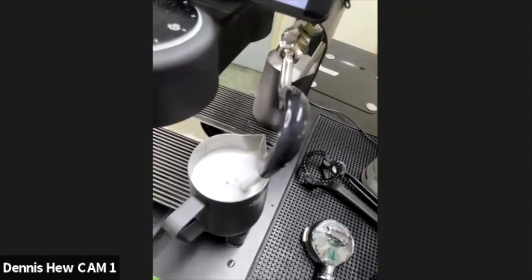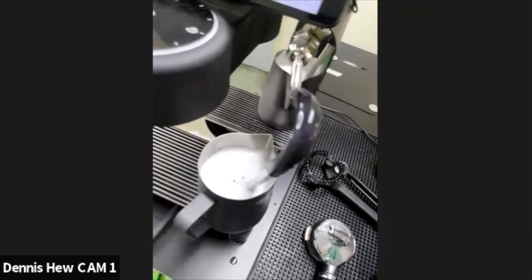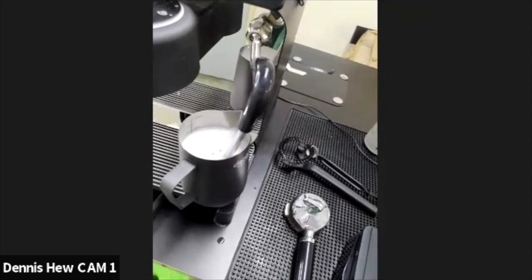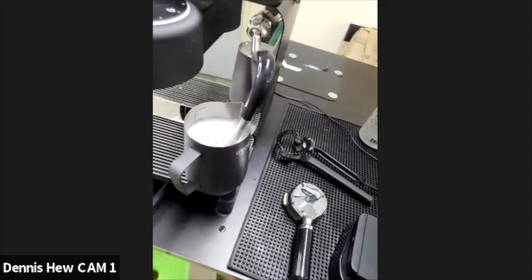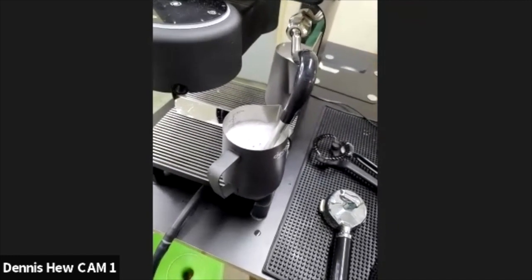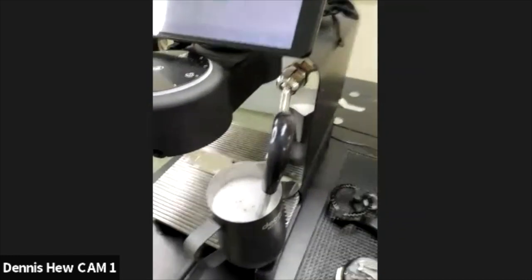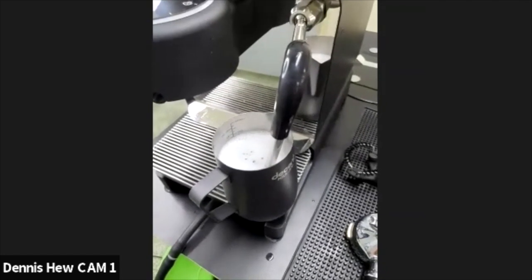Well, I think it could be possible. I don't really want to recommend anything that could potentially give you more harm. Why am I saying that? Because if your concentration of citric acid is not strong enough, you could perhaps not dissolve all the scale inside and leave a clump that could block your machine. So we recommend using citric acid to the recipe that we introduce for that reason.